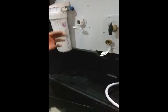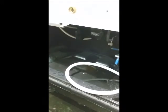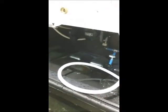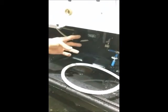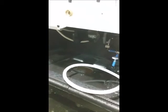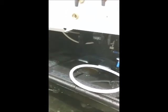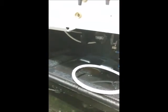Once the level reaches full, you're going to come back outside, turn your water hose off, pull your black handle one more time, let that dirty rinsed out water come out, and then you'll close that, and then you'll use the gray soapy water from your sinks and your showers to rinse out your sewer hose. After that, you have done the process and you're ready to continue camping.